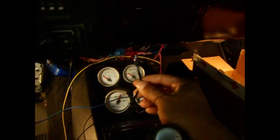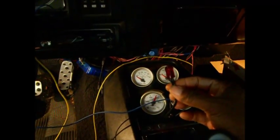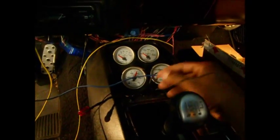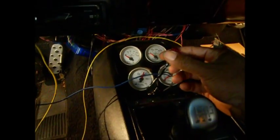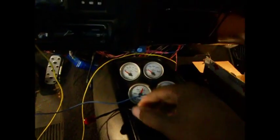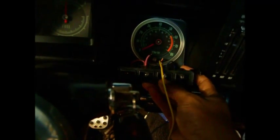We're going to hook up the trouble code light on my oil pressure. Now this is the second way you can do it — you can go to AutoZone and pick up this little wire. This is what my idiot light was before — my trouble code light. It has two leads: one for power, one for negative. It's about maybe $4. What I did was drilled a hole and stuck it in there, and it works fine. But the only problem is on a sunny day, you can't really tell if this thing's on — it's not bright enough to really hit you in the face. That's why I'm going to the dash light, because no matter what you're driving, it's going to hit you in the face.